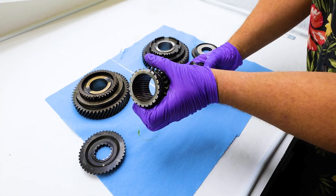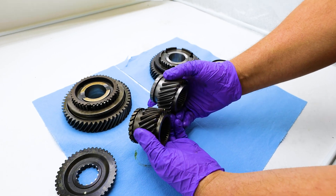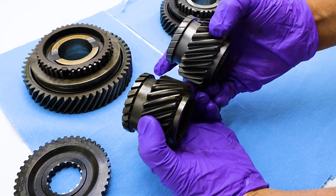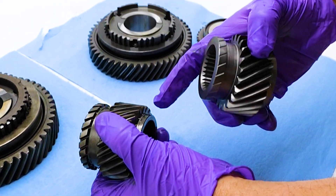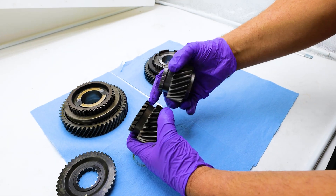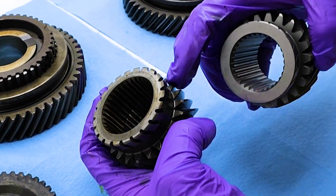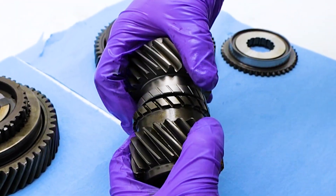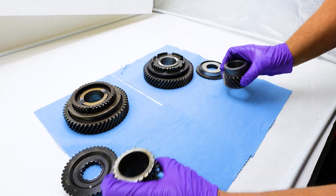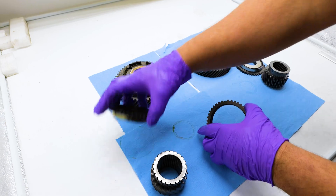The fifth gear itself — this had a full splined fifth gear and all of them should be fully splined. The gear actually looks to be in really good shape. Our teeth look good; it's not badly worn on one side more than the other. You can see it's a little polished but it doesn't look bad. This difference in the machining is just the remainder of cutting that groove there, and this is machined down a little bit smaller on our part, but that really doesn't make any difference on the holding power of that fifth gear.